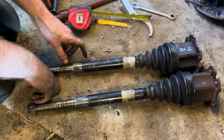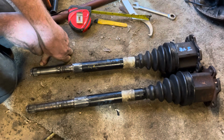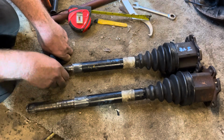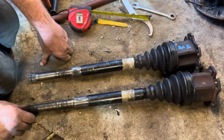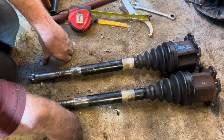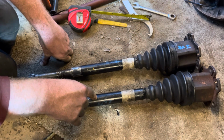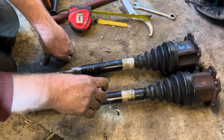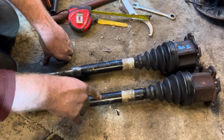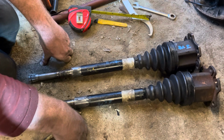I don't know whether to put a little bit of weld just on the bottom of the tube. The other option I've got, I'll leave it to you guys to maybe decide, but we could do it afterwards anyway. These shafts look a bit different anyway, the ends. Yeah, this goes down in there. Do I drill a hole through the sleeve, and then put a plug weld all the way through onto the mini shaft in there? Quite easily could do it afterwards actually, because we could just drill and not go all the way through, and you'd get a good weld anyway.